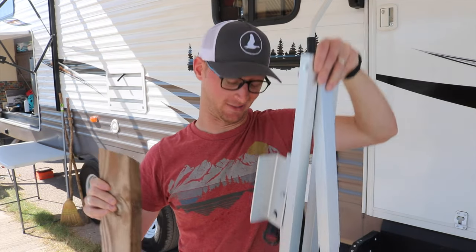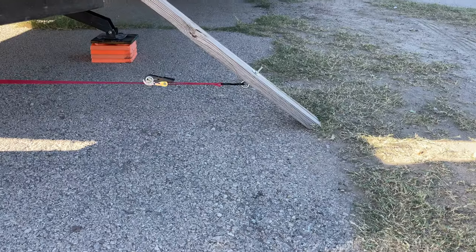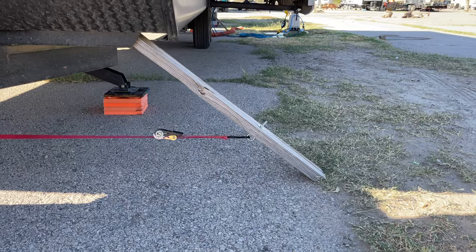So what did I observe — should you build it or should you buy it? I think you should build it, with some caveats. Just watching the bubble level on the spirit level, the DIY version stopping lateral side-to-side movement did phenomenally better than the Valterra. Which makes sense — it has a wider footprint and goes outside the frame versus inside. That's also a negative though, because the 2x4 sticks out past the side of the RV and creates a tripping hazard at four points that weren't there before.